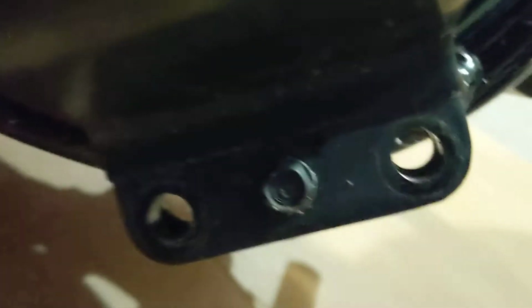So you got four bolts over here on the back part of the exhaust, two bolts 12 millimeter here. To recap, two 12 millimeter bolts right here, two 14 millimeter bolts, or 9/16 will work just fine. You're going to leave that center bolt in because you're going to take that off in just a moment, because on the other side I believe it's a 12 millimeter.